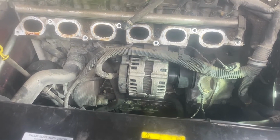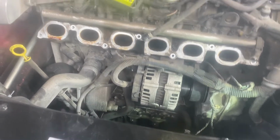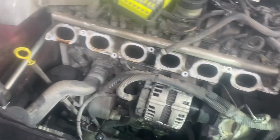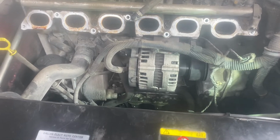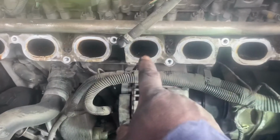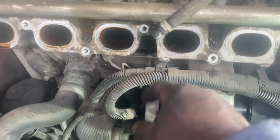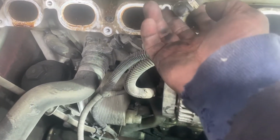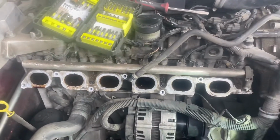Why? It's because Volvo has plastics and you also have connectors, and all these wires that come up to the manifold, that you need to carefully take your time to remove. Be observant of this connector there. You might need to replace it, or take caution that you don't break it whilst you're removing it. If you know you're not going to get it for that day, then it will be worth taking this hose from the overflow tank. Hallelujah.